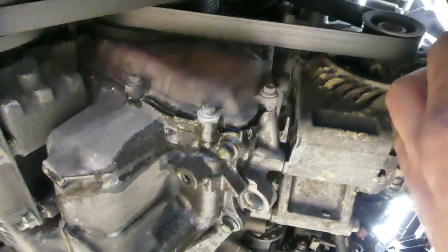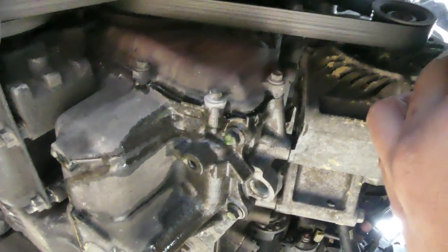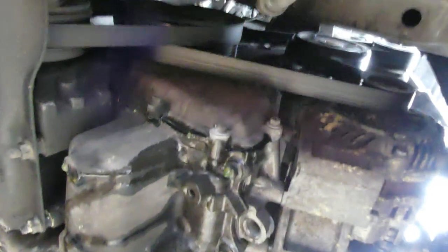Like I said, this car has been running for more than 20 minutes now, and I already find the problem. It's leaking so bad. Look at that. That's the leak. So if you press this, go into the thermostat, the leak will become worse. See that, just from the thermostat.